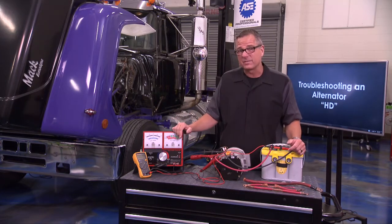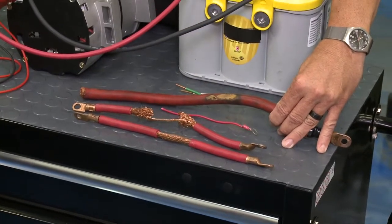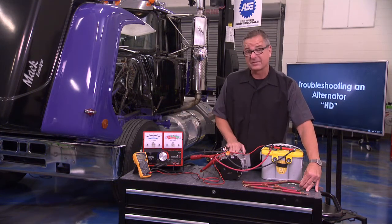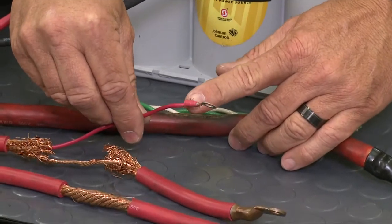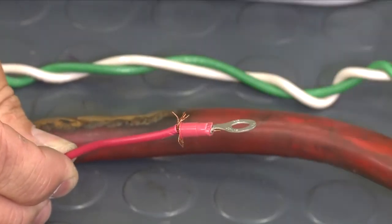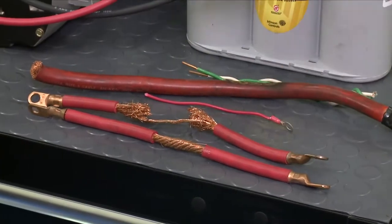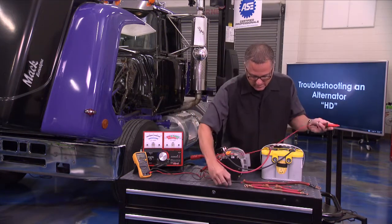What causes resistance? Well, resistance comes in many shapes and forms. Resistance is heat — see this wire right here that's toasted? If you run your wires near a heat source it's going to introduce resistance, and the alternator is going to have to work a lot harder, leading to premature failure. Wire connections are so important. This one here is all crimped up and butchered — it's not going to do the job. It may work with low amperage, but once you start pumping high amps through, it turns into a ginormous fusible link.